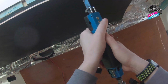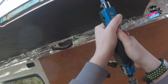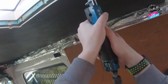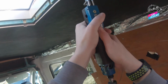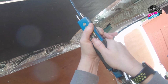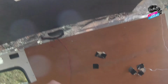So now I'm getting ready to put the skylight on. I'm actually putting up the ceiling panel so that we can squish everything together in one go. As you can see on the inner frame that I built, the lugs on the Mini Heki roof light are slightly proud of the frame, and so on the blue inner frame that I've built, I've cut out some lug holes there for them to sit. Well, I didn't account for that when I cut out the hole in the roof panel, so we just re-jigged that afterwards. Rather than take it all down, we just did it with an air saw.